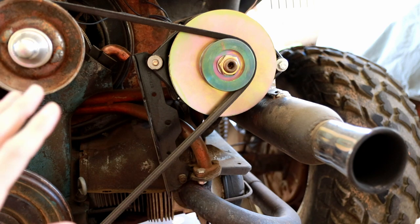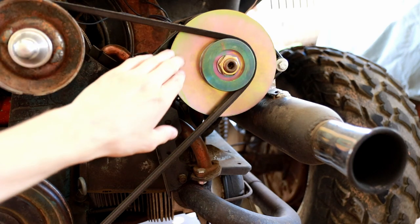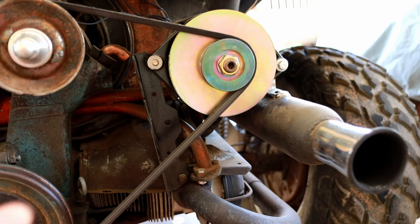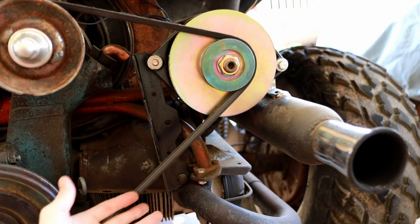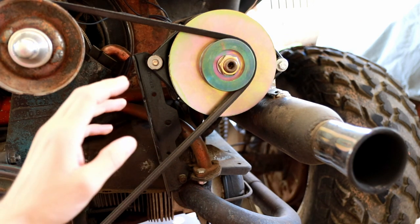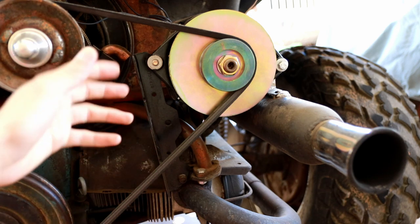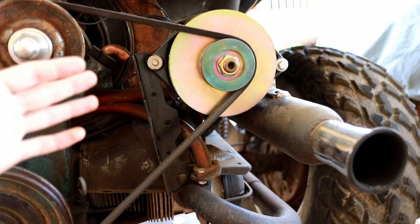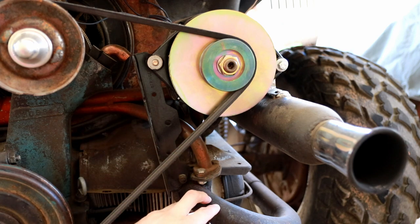Now I think this is a particularly elegant solution in that it allows you to put a similar type of alternator on virtually any VW engine you want. And it's really cool in my opinion because since the exhaust pipe comes off basically as two pieces and there's just a couple of bolts holding it on here, this can be moved from engine to engine. If I want to put a big alternator on my 1600 or if I build a 1776 engine, I can do that with almost no major modifications apart from installing this bazooka exhaust pipe.